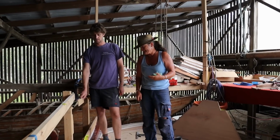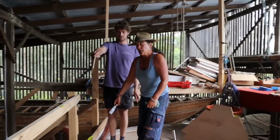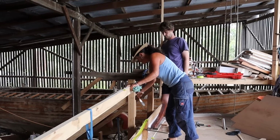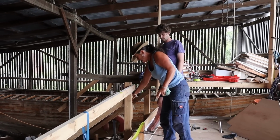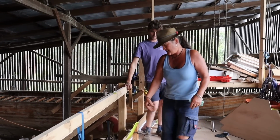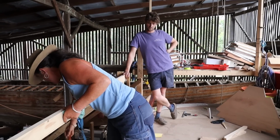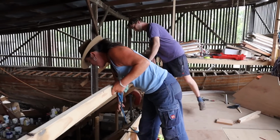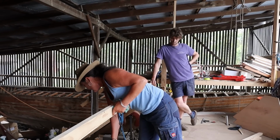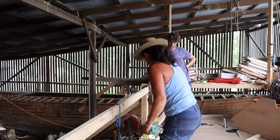You don't want this to be the spring off astern, like when you're coming astern, if there's a Panama here? I just don't want to move it too far, because it is quite far aft for a spring. And the other thing is, if you need a spring off, there's no hull there. True. So we need to be up here somewhere, where you've actually got somewhere you can put a good fender and fend off. So it starts to waste away there. So here, you'd have to spring off here, I reckon. Here is probably as far aft as you can go, and probably there is better.